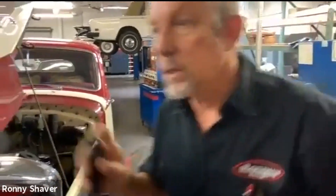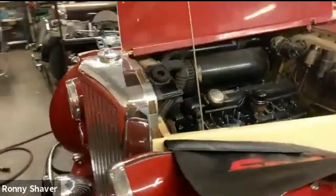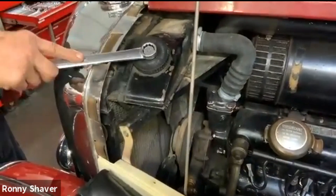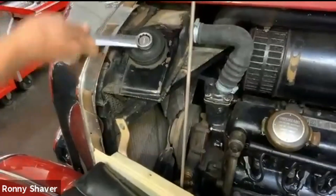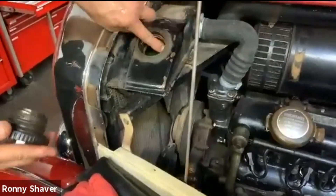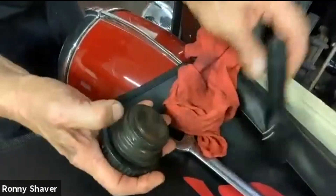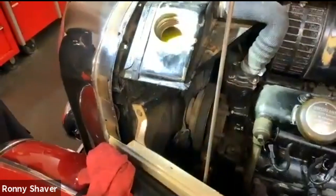What I used is that drain plug tool — it's almost the right size and it usually works pretty good, it's a little loose. The thing with these caps is this plastic slash phenolic cap has threads on it and the radiator has brass threads. A lot of times what happens is they have a seal on here — it's a rubber seal that slides over there. Sometimes it gets bigger than the threads.